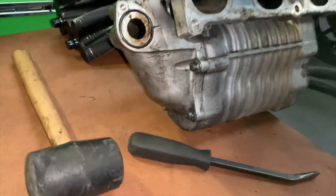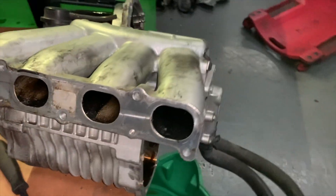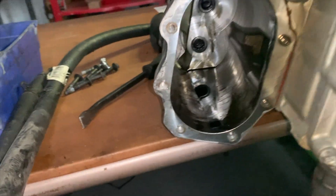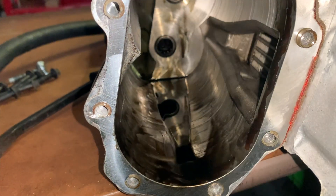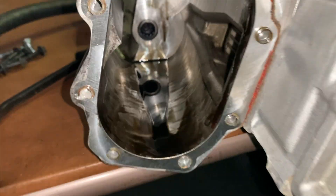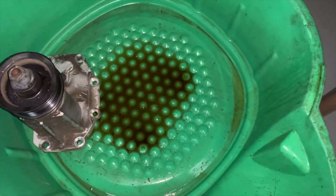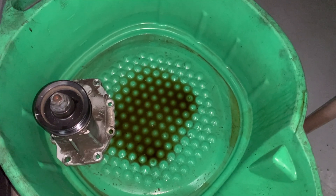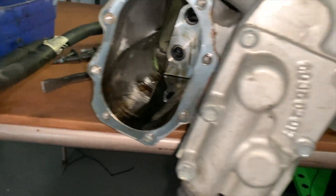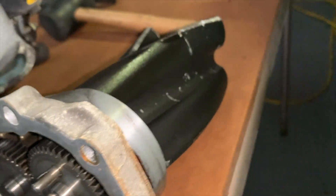As I had mentioned, it looked like there was a leak in the back of this thing. Since we saw metal flakes going up into the supercharger, I figured I'd go ahead and pop it apart and check out what's going on inside. Inside is scored pretty severely on all fronts, and there's a bunch of liquid oil just hanging out. That explains why we were only able to pull out about one to two ounces of oil when I pulled the nose off — fluid capacity on this thing is significantly more than that, as it's supposed to fill this cavity. When you look at the actual supercharger, there's plenty of damage on all faces of it.